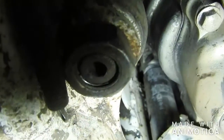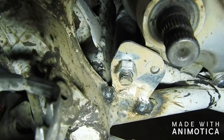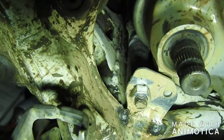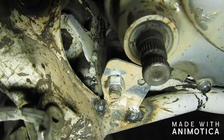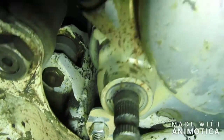So you got the motor piece. I made a spacer. You can see the spacer right there that comes all the way over to this plate piece, and it's another one on the other side, a custom size spacer. Both sides have these tabs that I welded on. I got to clean them up and start my paint. So I bolted it all together. The other motor mounts were already tightened up. Tightened it down, sat it where I wanted it, burned it in, and it's good to go.